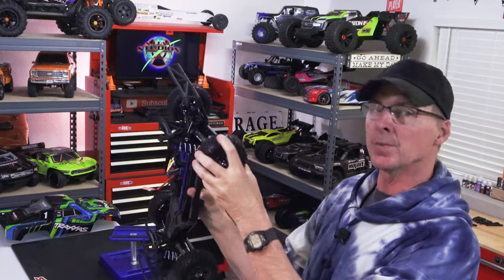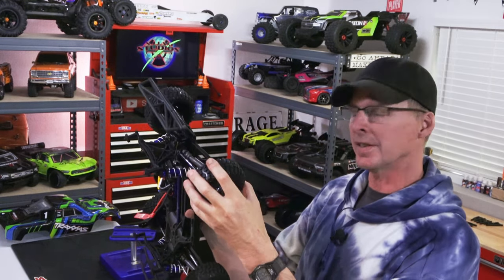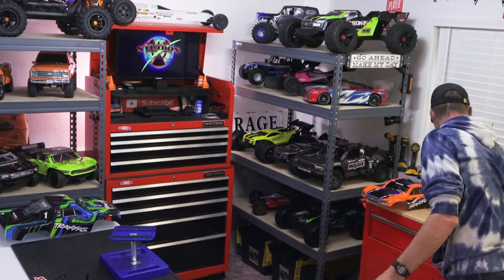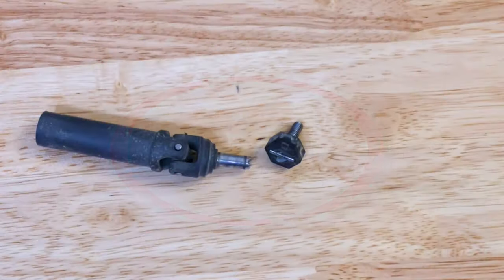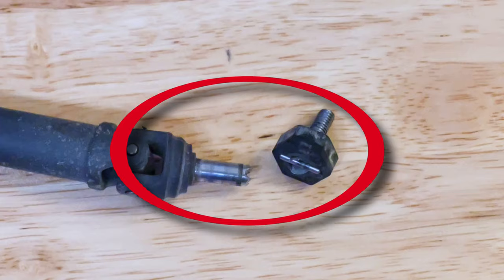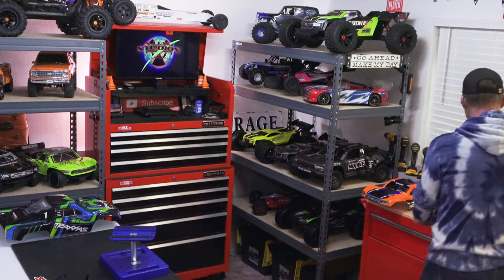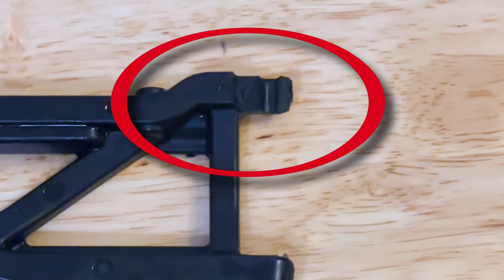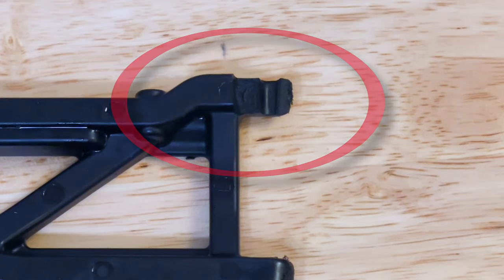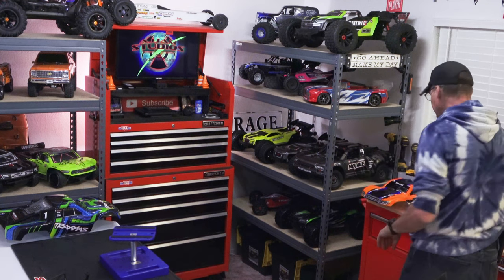We did also rip this wheel off and what happened is the drive stud that comes out failed right at the pin. So the whole wheel assembly came off and that's this bit here. And all it did was break it right there. And that's where the pin's at. If you can get a close look at that there, that's where the pin's at and it just broke that shaft at the weak point. And I don't fault that either because it did take a pretty ugly tumble. But the suspension arm simply broke this front part of the spindle. This is actually where the hinge pin goes through. It just broke the top off of that, but it took a lot of punishment to get it to do that. So overall, I'd say it worked really well.